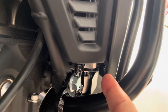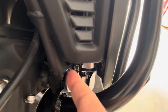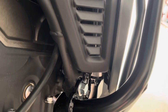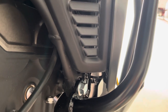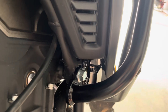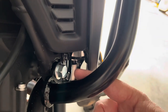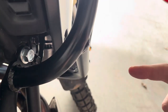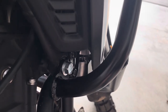The other issue is the distance — even though it doesn't look like it on camera — between the bolt and the plastics right here, the fender. This distance is not big enough for a socket, and even a short stubby socket wrench does not clear. So it's a pain in the rear end to get that out and put that in. What I had to do was put the socket on with an extension to get it out past there, and I was able to do it — but slow down and think about it, because that drove me crazy just trying to get the factory bolt out.